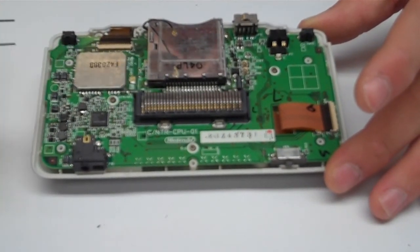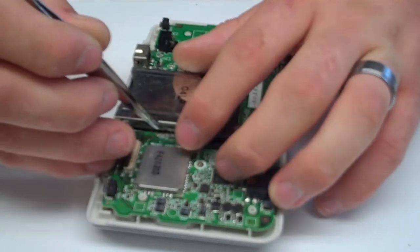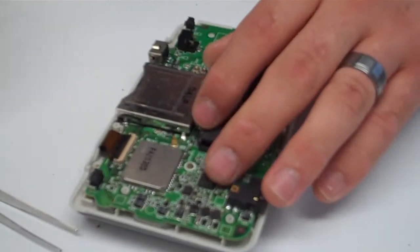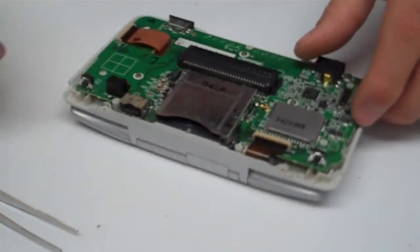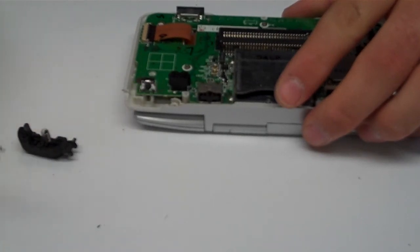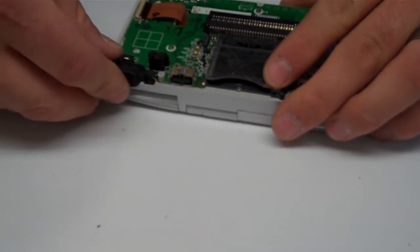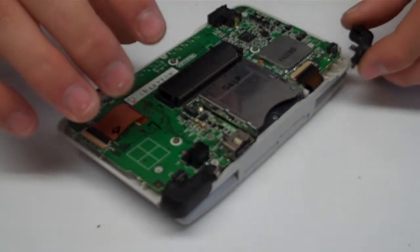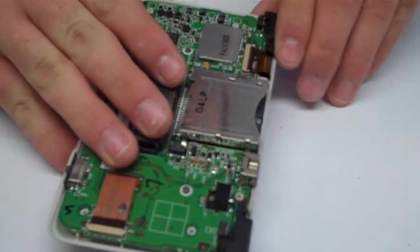Before putting the unit back together, put on your antenna cable and if you have any slack, turn it to the side so it's not going to lay over your screw holes. Then put on your left and right shoulder buttons — they're relatively easy. There's a little channel below the left and right shoulder buttons that the spring goes into, so set the spring into it and drop the button into place.